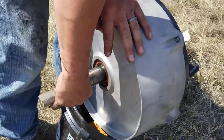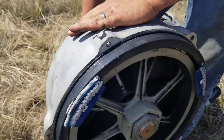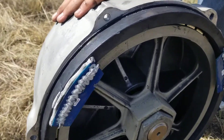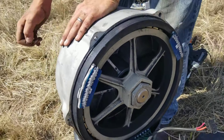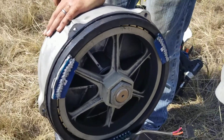I wonder if you can see it better on this side. I'm basically just going to lift up on the shaft. You see that play? Yep, I do. And that's what causes all that black stuff, because it starts rubbing on here and then it starts to short it out. This one you can see really well.